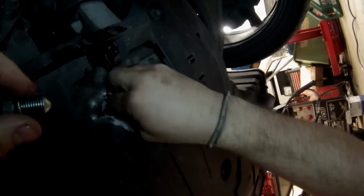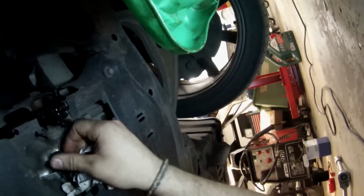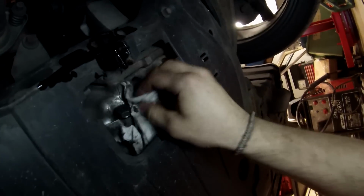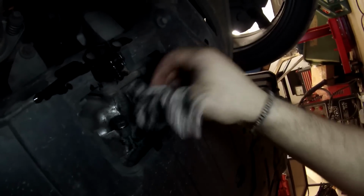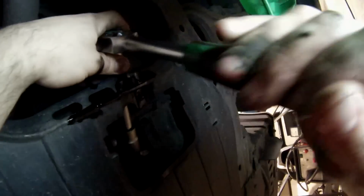Welcome back. Now the oil has stopped dripping, well, almost, just some minor drops left. So it's time to reinstall the sump plug. You don't need to change the plug every time you change the oil, but I recommend you at least change the washer. It's like $1 or £1, so that's nothing. Cheap insurance. Just hand tighten it at first, and then take your ratchet, bring it in the right mode, and don't overtighten it. Just apply some force, not much.